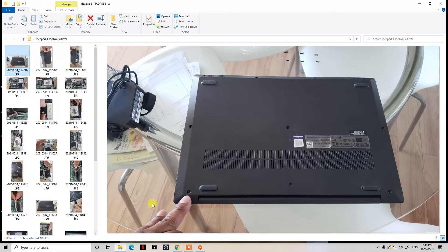First thing you do is flip your laptop upside down. There are three screws in the bottom, three in the middle, and four on top. The first six have the longer screws, all exactly the same size — put those in one pile. The four on top are shorter screws, so keep those together. There are only two types: long and short — keep them separated and you'll be good to go.